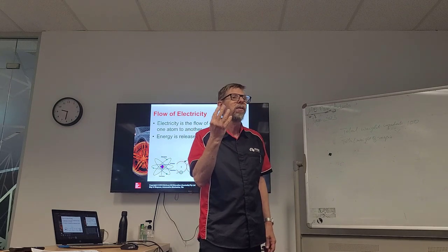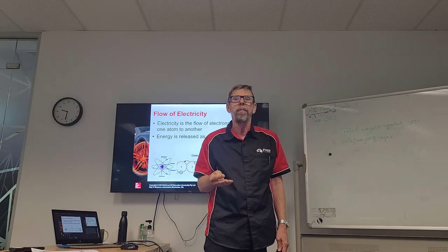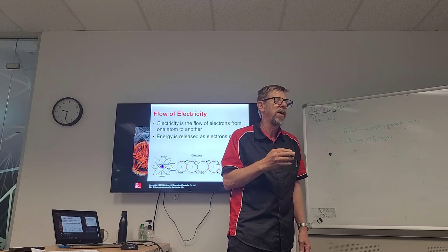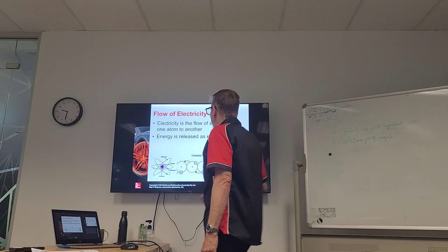And when your interior light was staying on all the time, and no matter what you did, you couldn't turn it off, you've probably got a short to power, okay? We'll talk about that more soon.